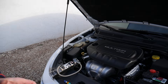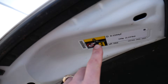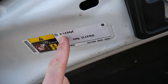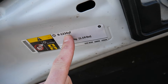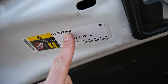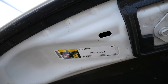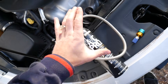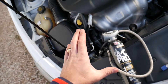On this Dodge right here, if you look at the hood label for the AC, you can see that it requires that special stuff known as R1234yf. This is that special refrigerant. Bad news: first, it's very expensive. Second, you need a special gauge to actually put it in the car because you cannot use the gauge from R134a.